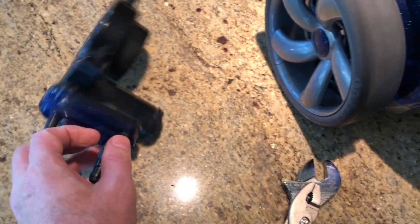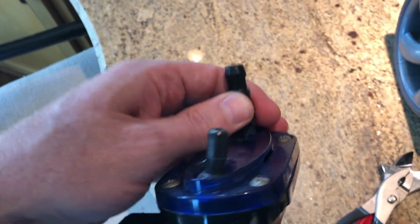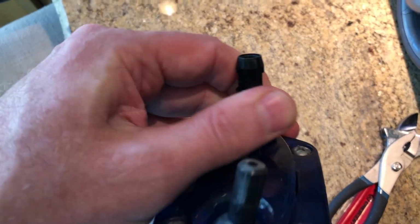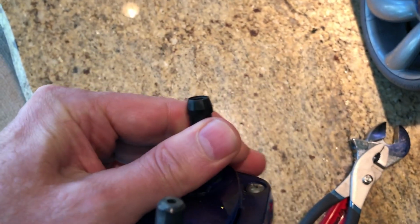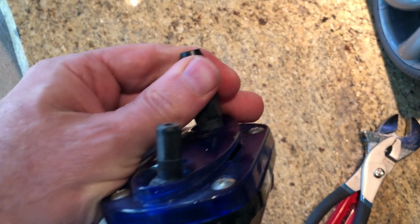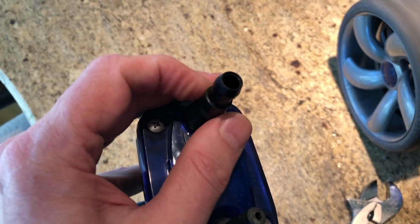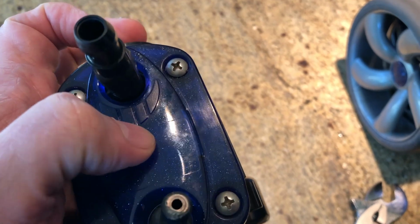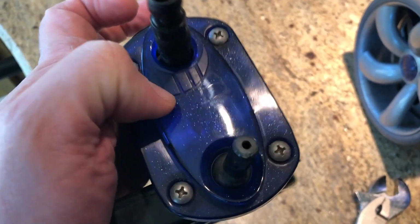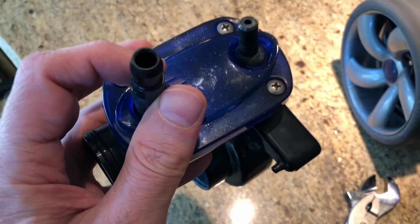The other way that we know, or that you can suspect there's damage, is you can turn it, but it sounds very gritty, almost like it's got dirt in the mechanism that allows the thing to turn, and it's hard to turn, right? On a new one, they're detent type stops. As you rotate it, it goes from the detent stop of 1 bar to indicate, hey, you're in the small setting, the next setting, the next setting. There are detents for each one of these bars that you'll see here, right? But it rotates through those detents quite easily.